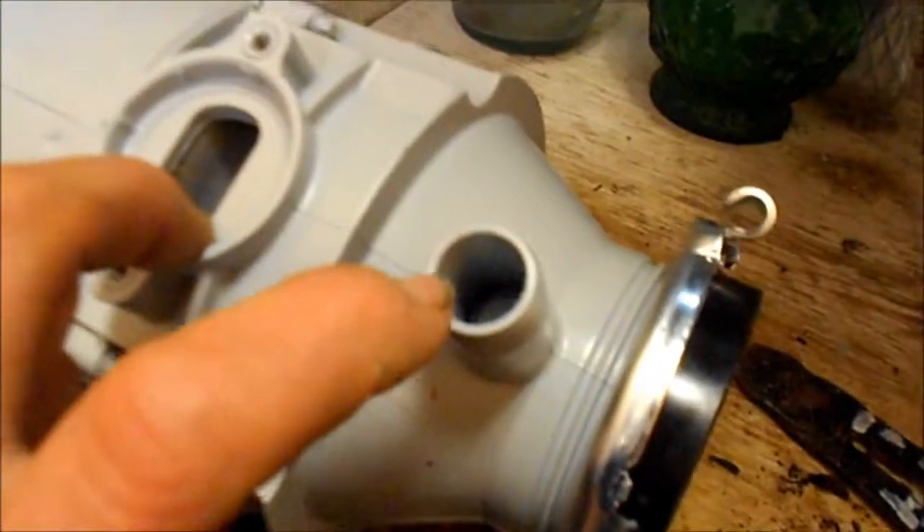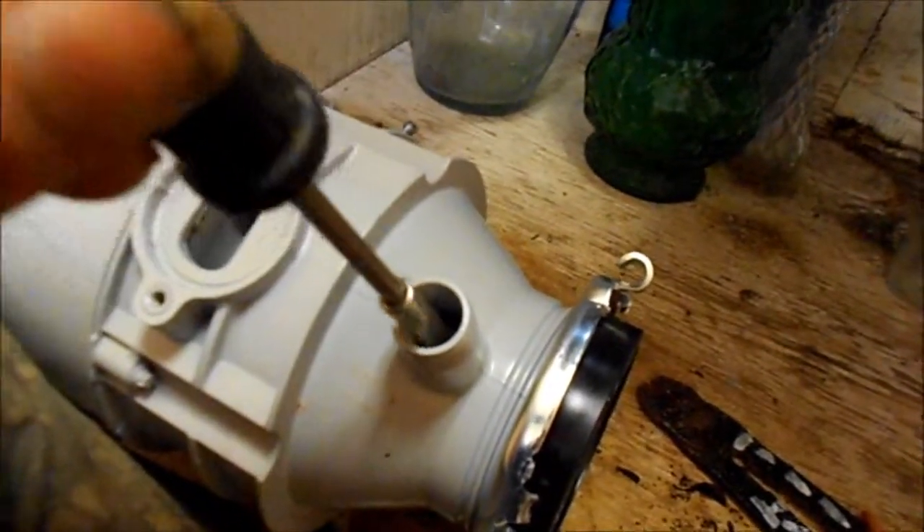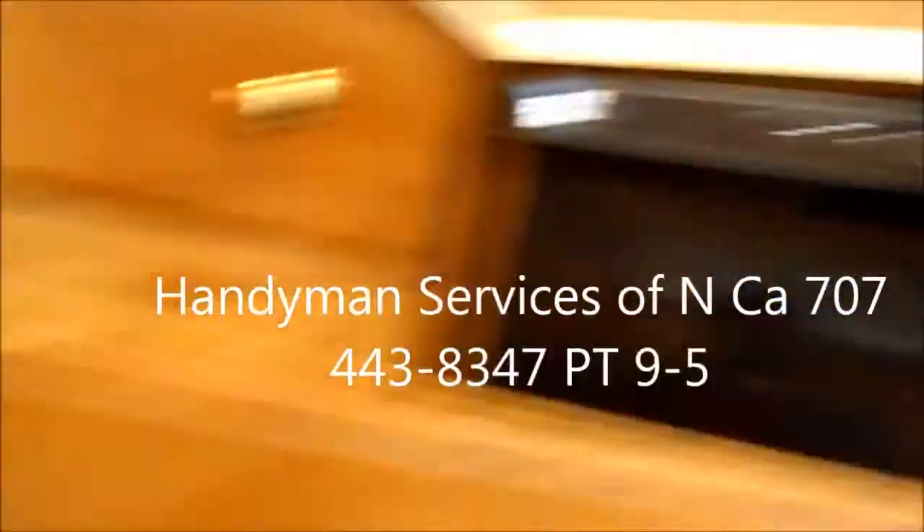They're plugged up because a lot of people don't have the dishwasher drain tube. So if you have one, you need to make sure and knock that piece out of there so it's clear — otherwise your dishwasher will not drain.